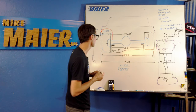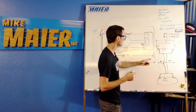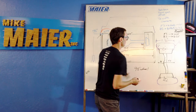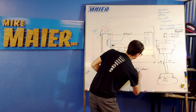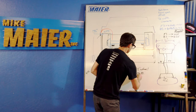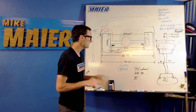That's how I get the wheel sizes. The back of this car will ultimately have a 9.5-inch wheel — that's what they'll call it — with an actual size of 10.5 inches, and a 6.25-inch backspace. Let's say it's an 18-inch wheel. You want to double-check this; wheel manufacturers have their own ways of doing it.